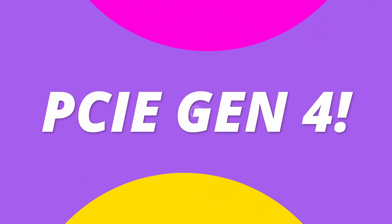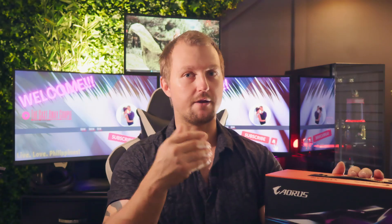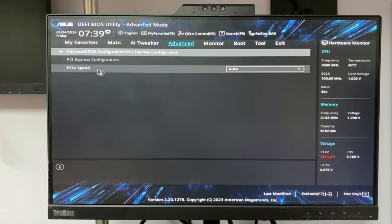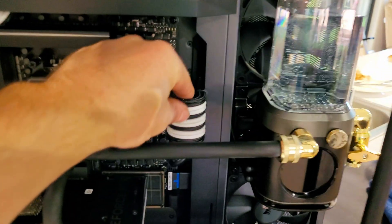Last but not least, you might want to try forcing PCIe Gen 4 in the BIOS. Some older hardware may have trouble recognizing the new GDDR7 memory used in the 50-series cards, so forcing the PCIe slot to run at Gen 4 instead of Auto or Gen 5 can sometimes resolve display issues. It helps stabilize the connection and bypass potential compatibility problems, especially with an older motherboard and CPU. Each of these steps is designed to systematically eliminate potential failure points — software, power delivery, or hardware-level connection issues — so it's definitely worth checking thoroughly before assuming your GPU is defective.